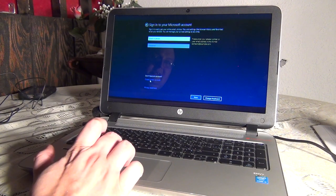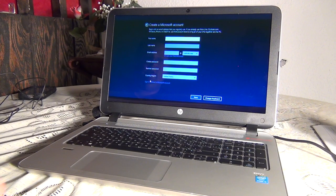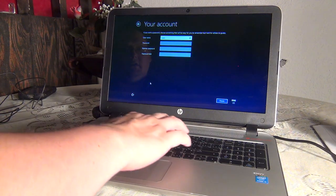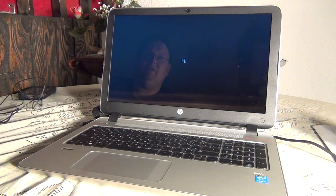Okay, so we're going to go to create a new account. Remember I said I wasn't creating one. We're going to wait. Now, at the bottom, there's sign in without a Microsoft account. So now we need a name. Unfortunately, I didn't get her name. Her son hasn't called me back. So for now, I'm just going to put owner, and I can change that after. So we'll click finish. And now we're going through the rest of the Windows 8.1 setup, and it's setting stuff up for us.